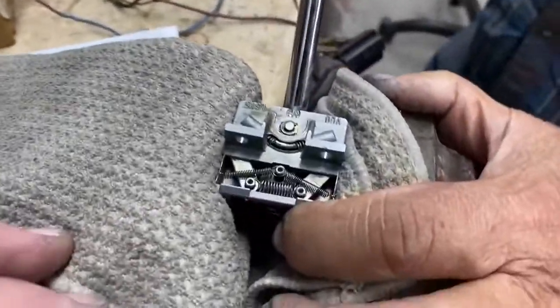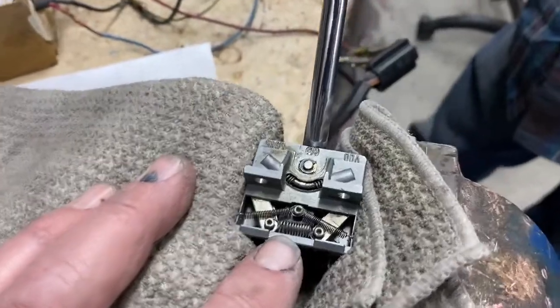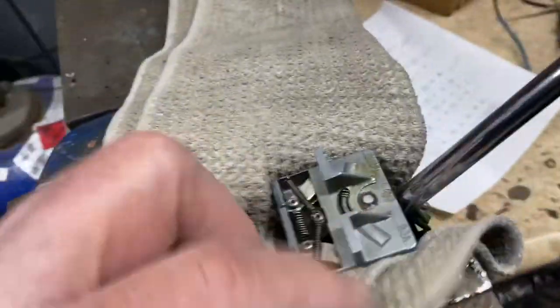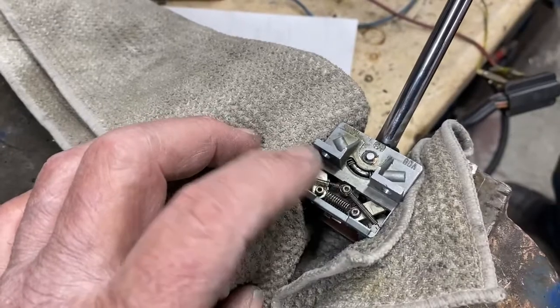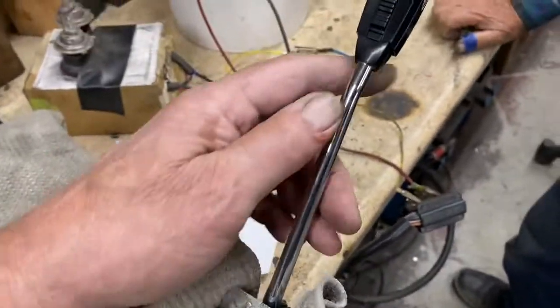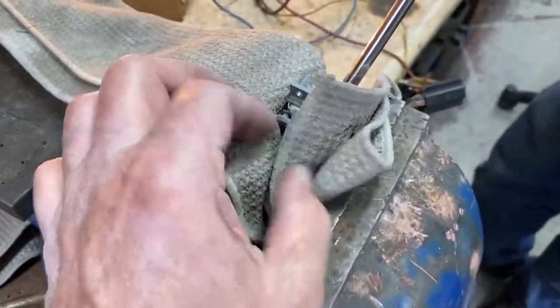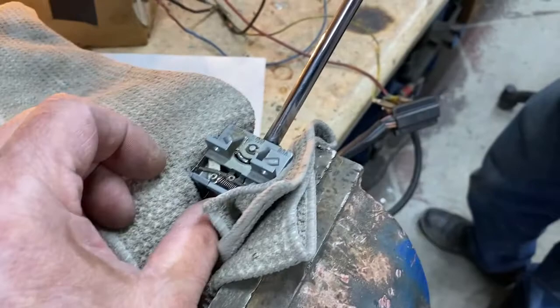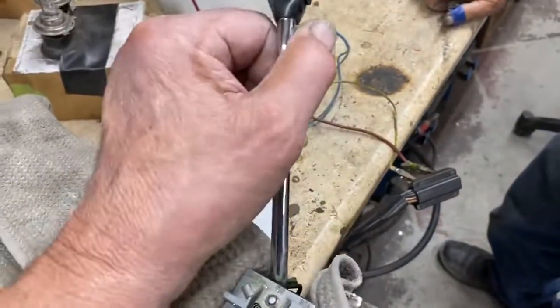The mechanism itself is made of die-cast material, which makes it pretty problematic because when they wear out, it's metal that's worn out. I've actually gone into this unit and re-pinned the vertical axis pins that are the detents for the turn signal — the detent that holds it in left — and then it manually pulls down or comes down by the trigger release quite easily, and it works that way on both sides.